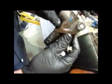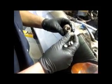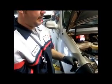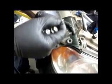Now this is the timing belt tensioner. These actually put the tension on your timing belt. If these go bad, you might as well not bother replacing your timing belt because you're really not doing anything. Now the way to know if these are bad or good is there will be fluid inside there. See this one — as you can see, it's no good. So that means you will have to replace it. Now the new one comes compressed with this ring here, and it goes inside that hole. We actually recommend you replace them — because if you're already inside there, you might as well replace this.